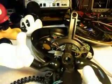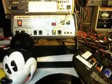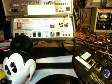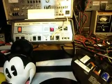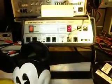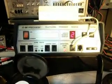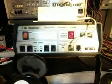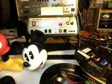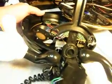Okay, I'm going to go ahead and answer it, and basically now we'll have dial tone. I'm just going to hit a couple of numbers because the keypad is up underneath here. I'm just going to hit a 2 there, so we know the numbers work. We'll check the modulation. Every time that red light lights on the analyzer, that shows 100% modulation on the transmit. So we know all that is working, and I'm going to go ahead and reach over and press the demo button.